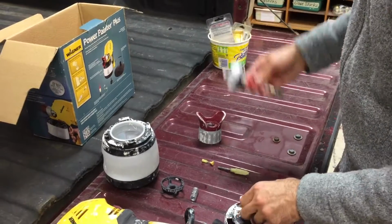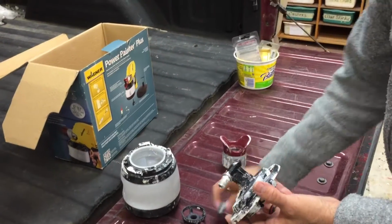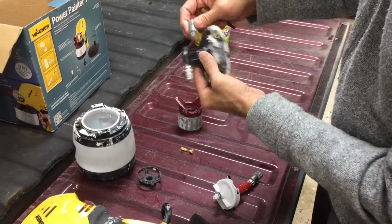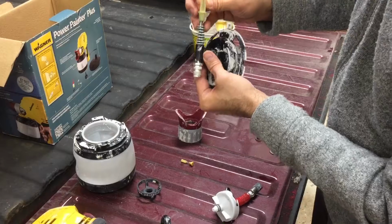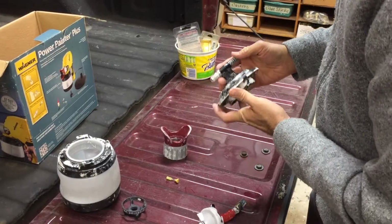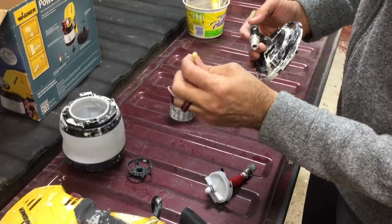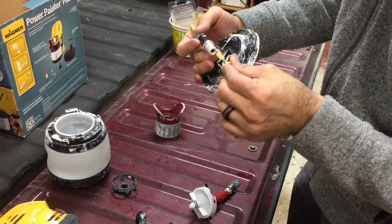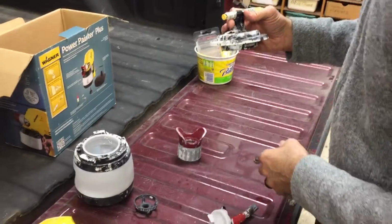Okay, now that that's done, the next major piece is the head. And so there's a spring and a pin. And so the back of the gun has this little lip where the spring goes, and then this pin seats inside of it with the metal pin forward. Okay, and that's just going to go back and forth inside the gun. The next thing is, this is the most critical piece of the whole tool, and that's the little spring with the little paint tip. And the little shaft here goes inside just like that. And it'll just be in there, springing and kind of loosey-goosey.